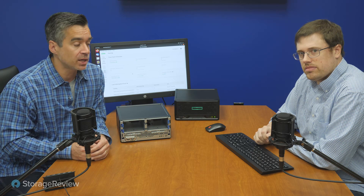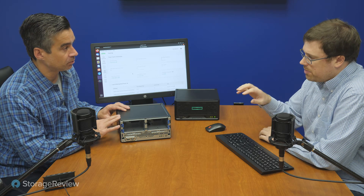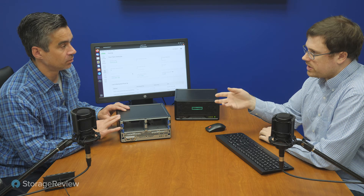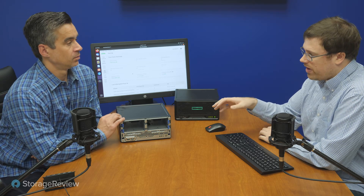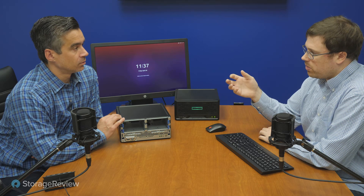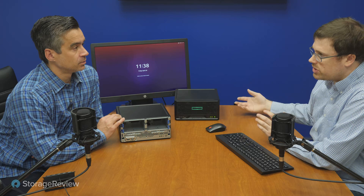That's actually part of why we like the HPE MicroServer Gen10 Plus — beyond being solid hardware with iLO for out-of-band management, it also has a PCIe slot on the back which we'll get to. From a technical setup standpoint, we have Ubuntu booting off a USB drive. It's available right now for around $550 to $600 with 16GB of RAM and a Xeon processor at about 3.4GHz four-core, which is not bad for a plotter. It holds 3.5-inch drives natively and can expand with JBOD options.